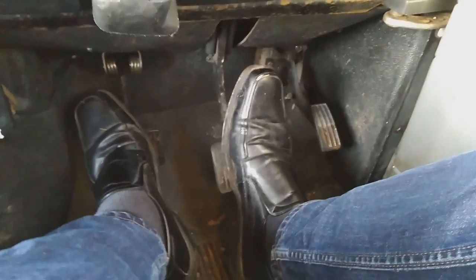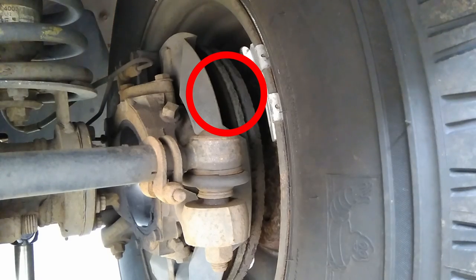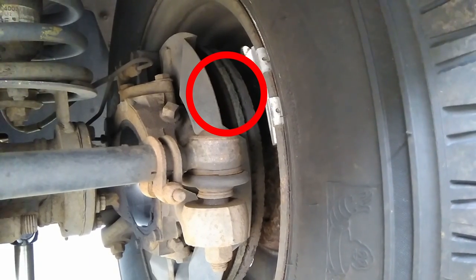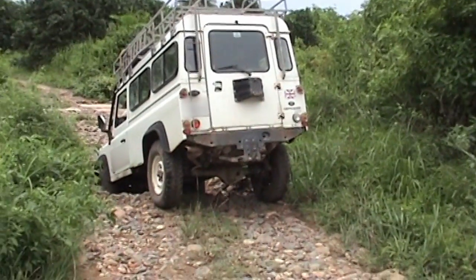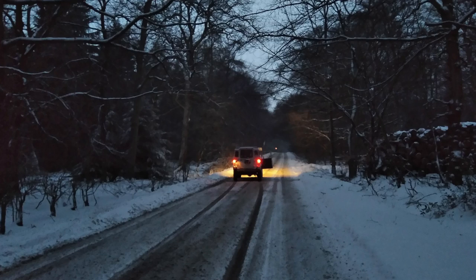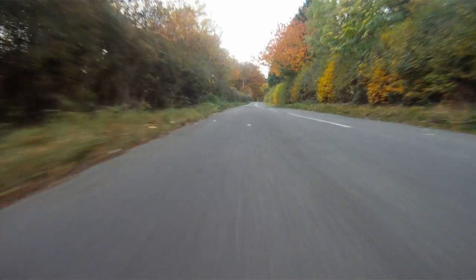I'm happy to report this actually solved the problem with my brakes. They were a lot firmer than they were before — still not quite as I would expect from the factory, but they've made a massive improvement. Here you can see me waggling the wheel after adjusting the bearings; you can see the difference it's made. In reality, you should be able to skid a Defender on tarmac with good working brakes — if you can't do that, there's probably something degraded within your braking system.